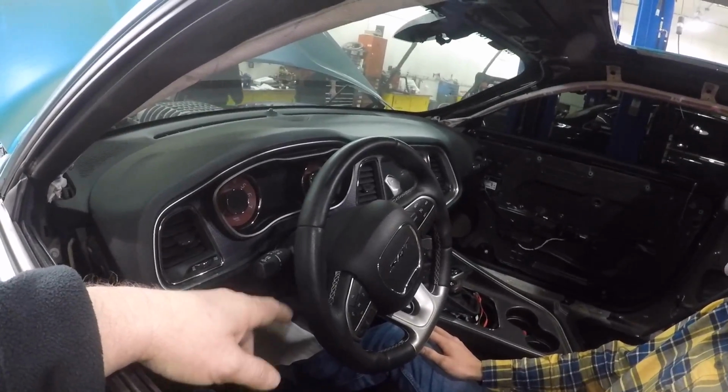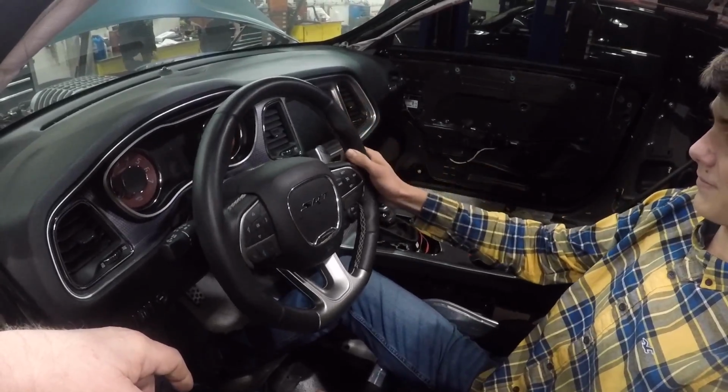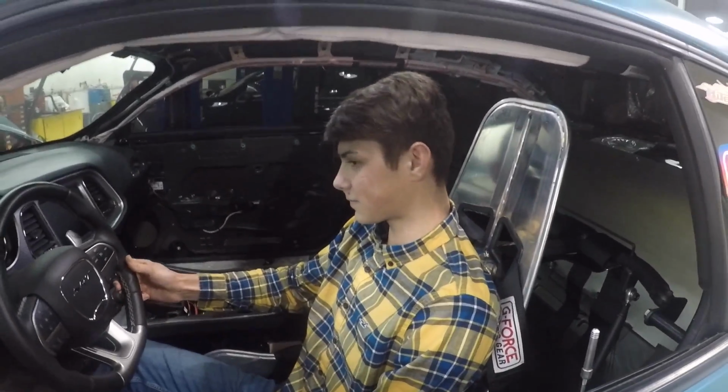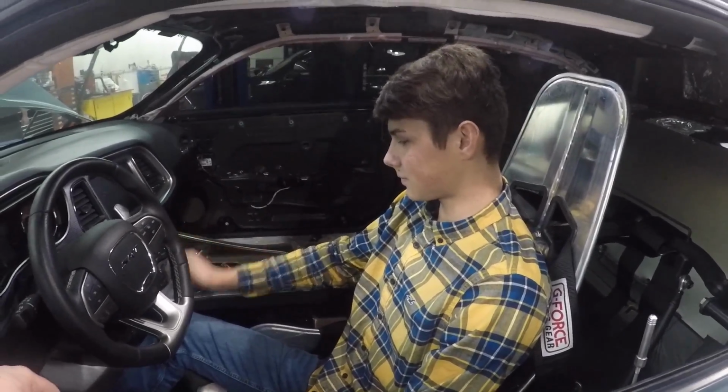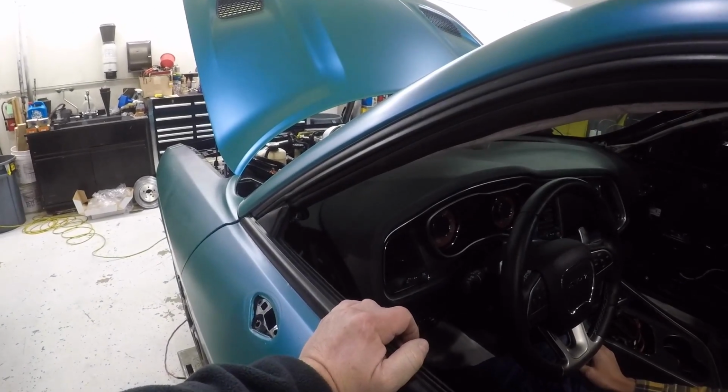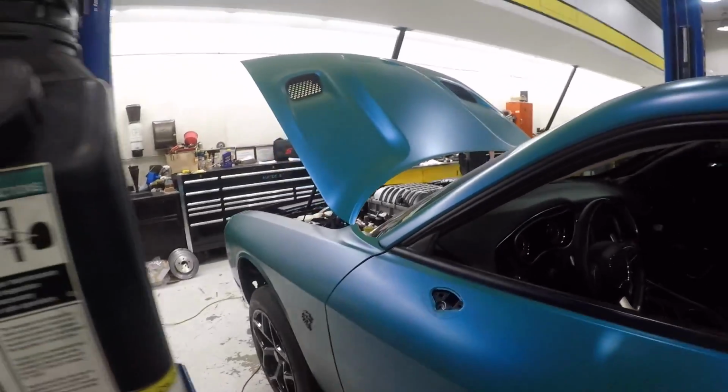So the power wheel will work when the thing's fired up and moving. We put the console back in because of the automatic. Everything works pretty good. We had it on the dyno, and then it pooped out the computer. We made some changes from there. We did put a set of Brisk plugs in it, one heat range colder. Forget what the number is on that, but I'll list it.